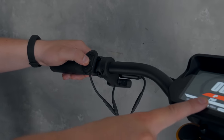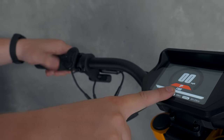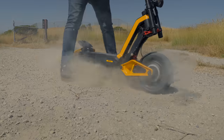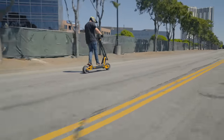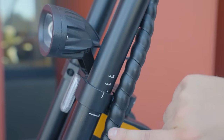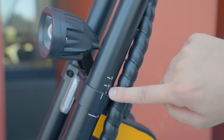Using the cruise control button while the scooter is stopped, you can switch between dual motor mode and single motor mode, with either the front or back motor receiving power. Having a front-motor-only mode is kind of funny since I can't really think of a scenario where you'd only want the front motor running, but it does make for some cool burnout shots. If you ride in single motor mode to save battery or make acceleration more manageable, just use the rear motor since that's where your weight naturally shifts when accelerating.